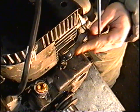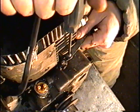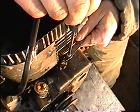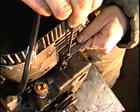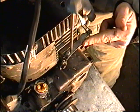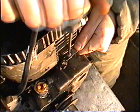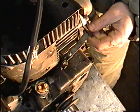You can see it's more on an angle and I've tightened the screw. On the other hand, if it's running too slow at high speed you would go the other way and then tighten the screw. I'm going to put it back the way it was, which is just slightly angled toward the carburetor — that's usually the correct setting for these.